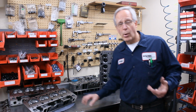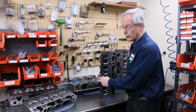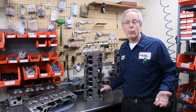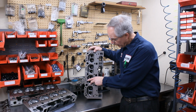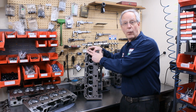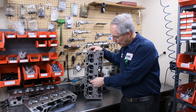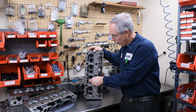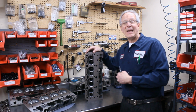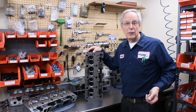And also some of the things that we wind up finding when we go to the extent of inspecting the heads and pressure testing is, some of the cylinder heads will come through with some flaws that sometimes you just won't notice until you get further down the road into the preparation work on the cylinder head. This particular head has some welding right around the cooling holes. Now, sometimes castings are repaired. Sometimes there's a weld on a corner or on an intake flange and so on. This particular head cannot be used because the welding wasn't done very well, and there's some actual pinholes that are going to be right around the firing ring. So you don't want to spend your hard-earned money getting a cylinder head and not having it be the correct head and having some flaws in it as far as the machining is concerned.